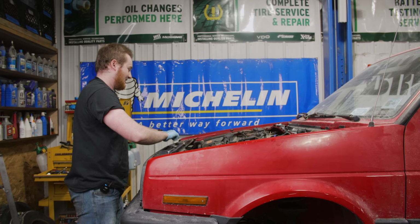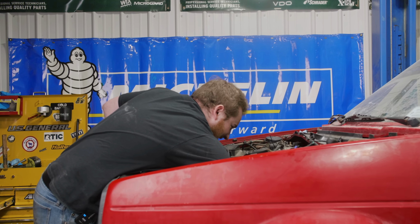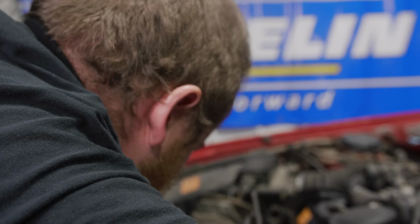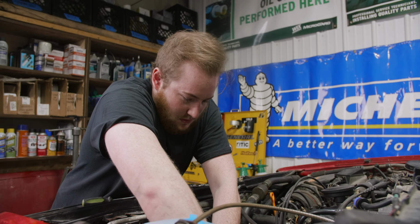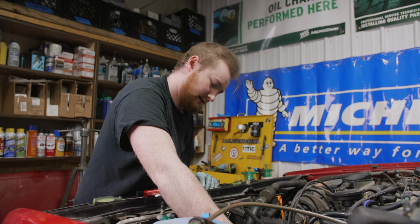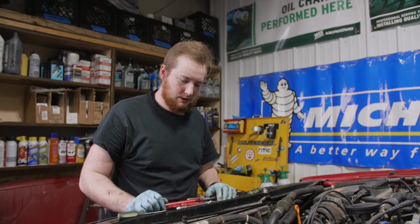In fact, with every step I take, I'm beginning to think driving the car will be a tomorrow thing. This thing gets warm so quickly. Things were going pretty well until I reattached the clutch cable, and even with it all the way extended, there was still too much play. Kind of a classic sign that something was done wrong. That is simply bizarre.